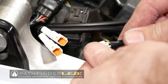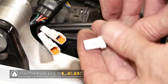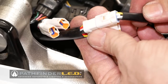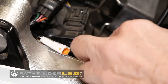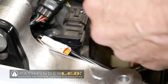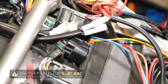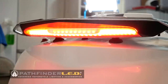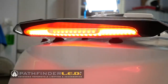Now we're ready to connect our multifunction light to the harness that went under the trunk. Make sure you're connecting the one with the yellow wire — it should be the shorter of the two. Tuck all the other connectors and wires down between the frame components. Now we can test our lights to see if they work. Turn on the light — we have a running light that works. Check the right turn signal, then the left turn signal. And let's test our brakes.